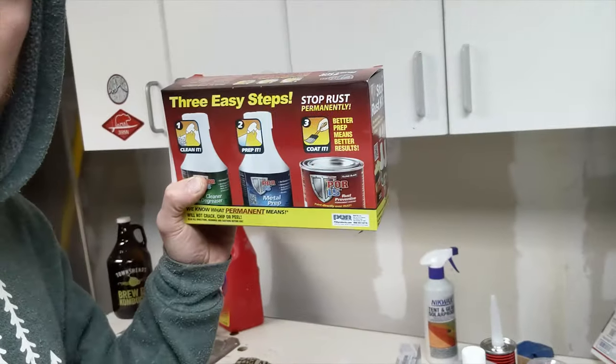I'm honestly a bit disappointed. I was really hoping to get that windshield frame coated in the next couple days, and we're leaving for two weeks on Monday. Unfortunately I can't stop myself from researching the right way to do things. I bought some POR-15, but then I started reading reviews — some were not super favorable — saying that it does not adhere very well to clean metal.